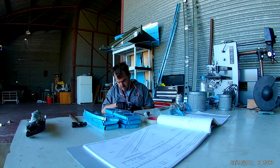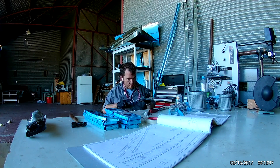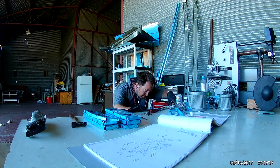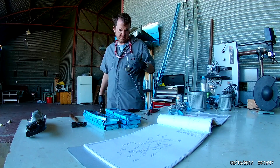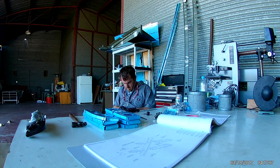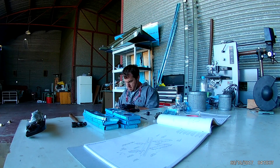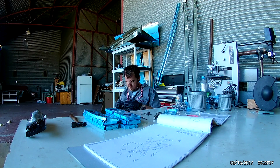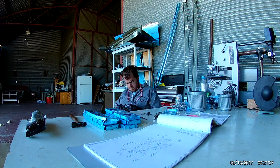Now there are two different types of ribs. There's just a plain rib that goes between the two spars. The way the horizontal stabilizer is set up — you can see above my left shoulder, the two spars leaning up against the wall, primed, and somehow you have some pieces riveted to it. So there's ribs that fit in between those two spars, then out the front of the front spar are some nose ribs, and out of the back will be the elevators.